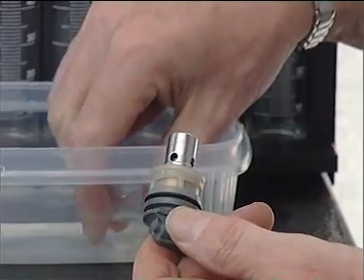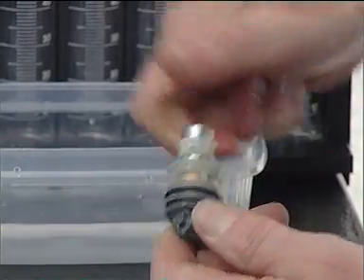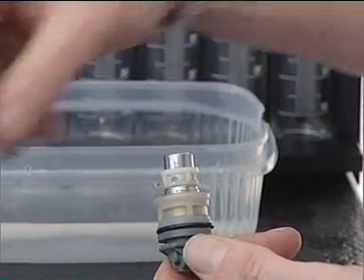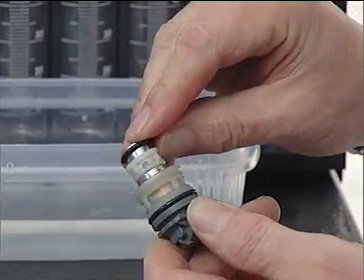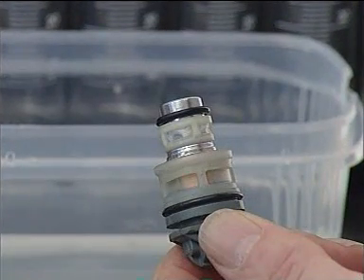Remount the injector, first flushing the cleaned injector into a waste tray as explained in the ultrasonic cleaning section of the DVD. After cleaning or fitting new filters, retest the injector again following the same process as the first test. Always retest all injectors after replacing any filters.